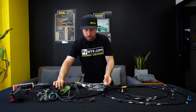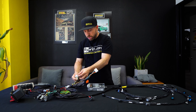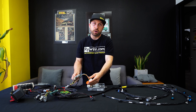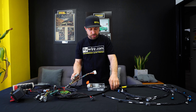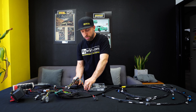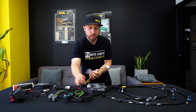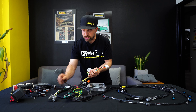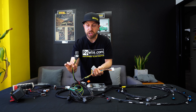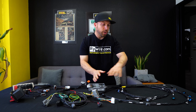These are equipped with what we call the C101 plug, because that's what it is in the service manual. These two plugs will connect together, and then it'll have the third ECU plug on the chassis side, just like an RSX. So if you're familiar with how the RSX works, this is essentially an RSX layout with the two ECU plugs, and we have a third ECU plug that plugs into the ECU. These harnesses are fitted with the engine harness integration, an O2 sensor for the primary, an O2 sensor for the secondary, an O2 sensor relay, OBD2 port, and interfacing for the chassis-specific car — in this case an EG or DC.